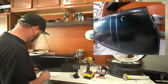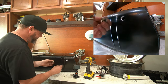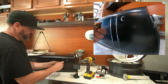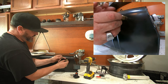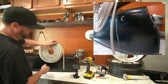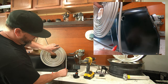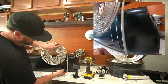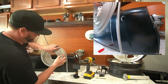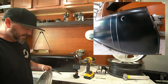That cutter leaves a nice edge. The fitting is going to poke out from the inside, this is going to thread on from the outside and sit just like that, then we connect our fuel line to it. The way we get the fuel line down to the bottom is through this - we've got to measure it. We don't want it to sit exactly on the bottom, we want it up just a little bit, and we also have to put a bend in it. Let's go fast so you can see me do this and then we'll explain it after.